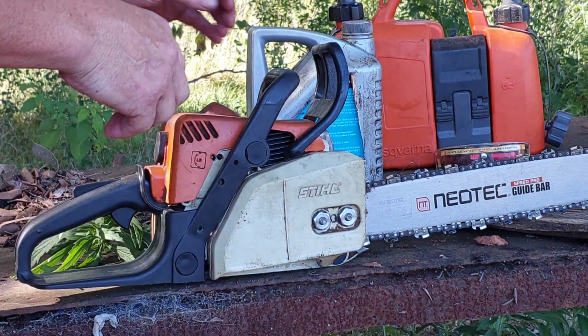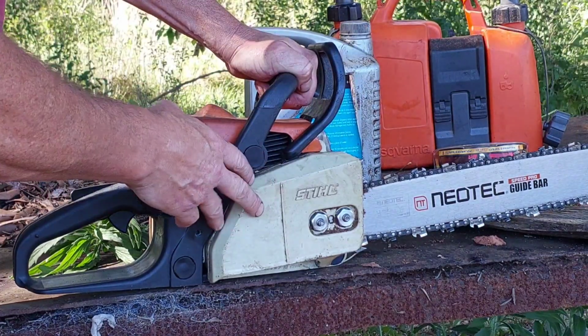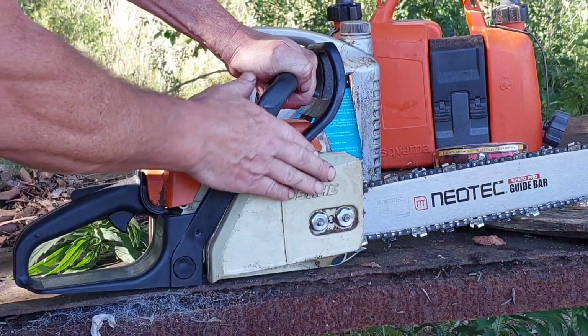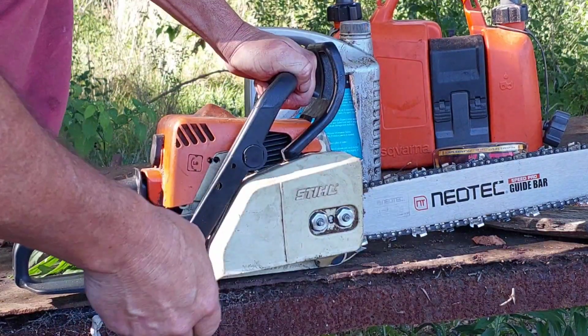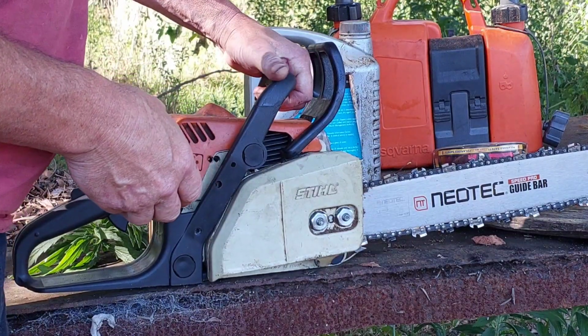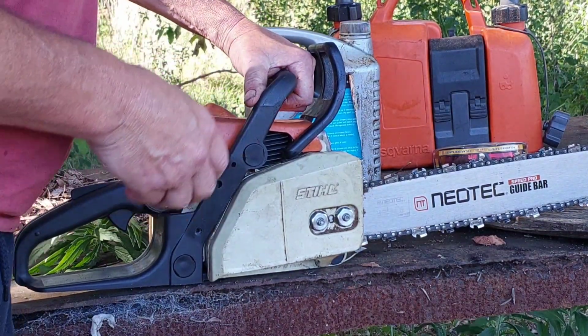Dirty Ralph's had a haircut, so poor job. 81 on the intake and 99 on the exhaust. Squish is terrible, 53 thou of an inch. Yeah, 53.